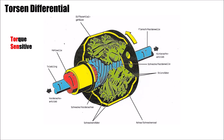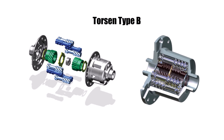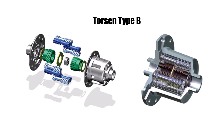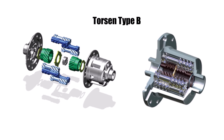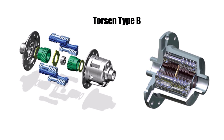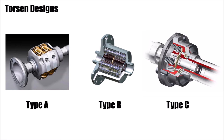The angle or pitch of the gears decides how much torque can be transmitted to the axle with more grip and hence less RPM. These transversal gears allow quite big torque bias ratios. Another Torsen design is the Type B — here components also have the same dimensions, so distribution is 50/50, but the connecting gears are parallel. This allows less locking function and a smaller torque bias ratio, considered more comfortable and quieter, but not really what Audi was looking for.